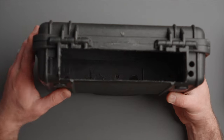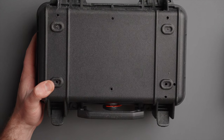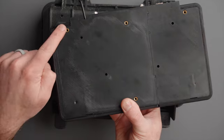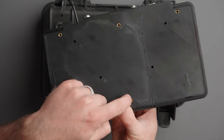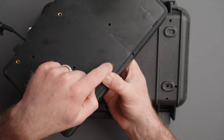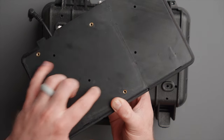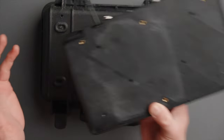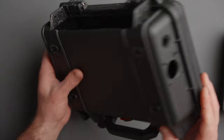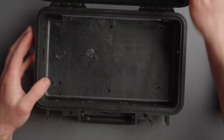If you want, you can also make holes on the bottom to match the four brass threaded mounting inserts on the rear of the base. You could use the included screws — they're already pre-screwed in — just loosen them and not use them, or drill the holes. If you aren't going to drill the holes, I'd recommend once you get this thing close to seated, add a little bit of super glue or hot glue and you'll be good to go.